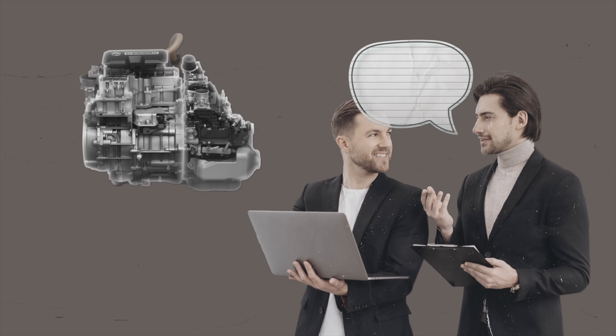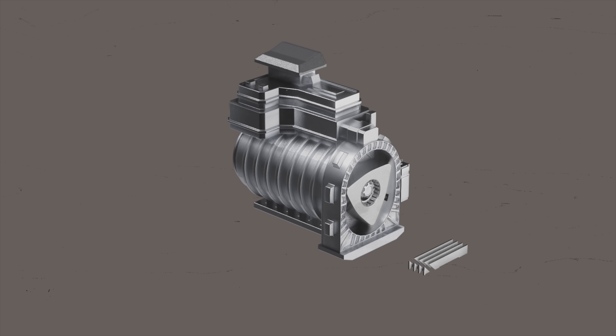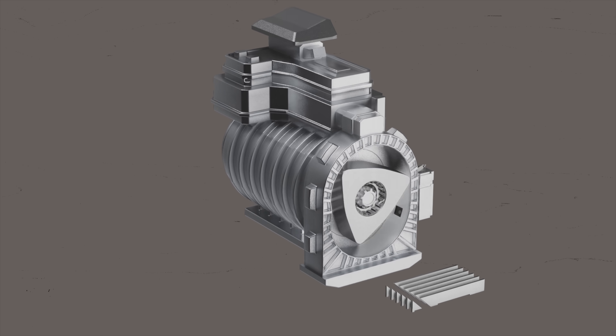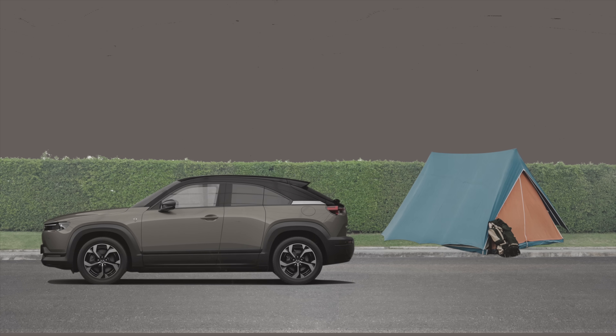Carbon dioxide emissions are lower too. Mazda increased the rotary engine's compression ratio to 11.9 to 1 to help extend the engine's life, and also made the apex seals thicker with a new specially developed coating to reduce wear and tear. Interestingly, you can also use the REV's rotary engine to generate electricity for emergencies, camping, or job sites.